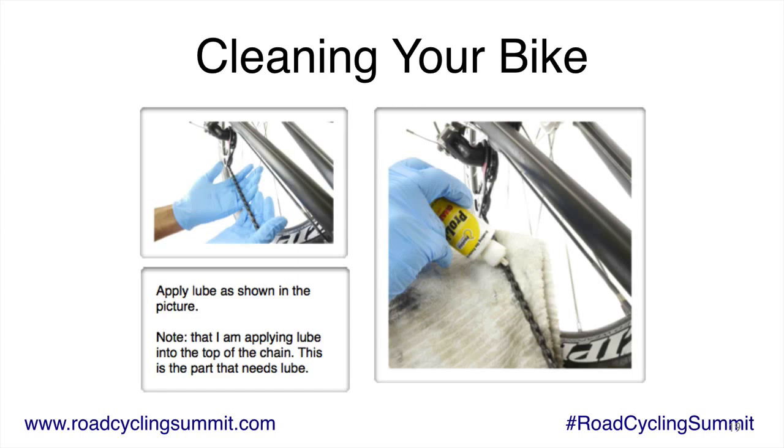And you'll see a lot of people will put lube on the cogs in the back. You don't want to do that. The only thing that needs lube are the inside of the links in the chain. That's it. And you don't want lube on anything else.